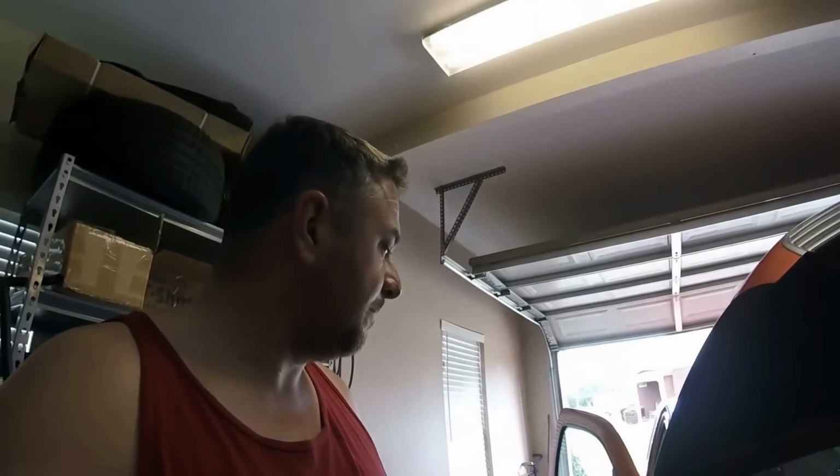Those of us fortunate enough to buy the first ones out, the 2006s, underneath this plastic cowl is a rubber butyl seal that would come off and would allow water down into the air box. I think they fixed it for '07, but definitely the later ones don't even have that rubber seal, so you guys are lucky. But you might have to replace the blower motor. I mean, things go bad, so anyways, my issue is I got water down in there.